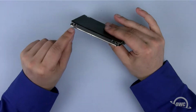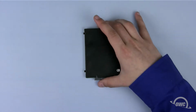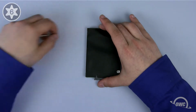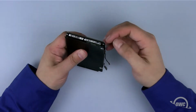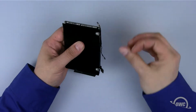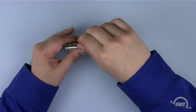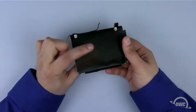For the top hard drive, first remove the 2 Torx T6 mounting screws. Gently detach the heat sensor, noting its placement as you'll need to reattach it to the same spot on the new drive. Next, gently peel off the drive covering, being careful not to tear it. It's held in place with a mild adhesive, but you'll also notice it is taped down in spots as well.